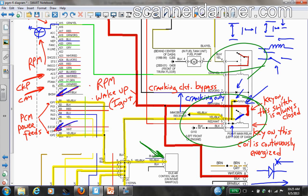A lot of systems are similar to this. The key is being able to dissect the wiring diagram — understanding power/ground side switching, which we're covering in section three: Output Solenoids and Transistor Drivers. Also knowing that coils of wire need power and ground, and changing your highlight colors when crossing a coil — that's really the key to dissecting diagrams and understanding relay circuits.